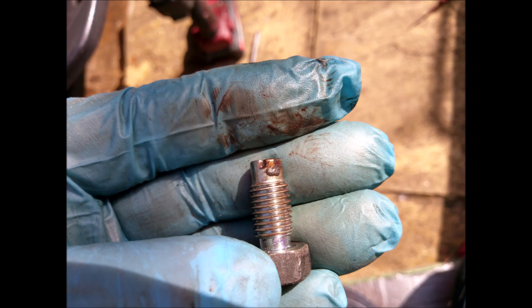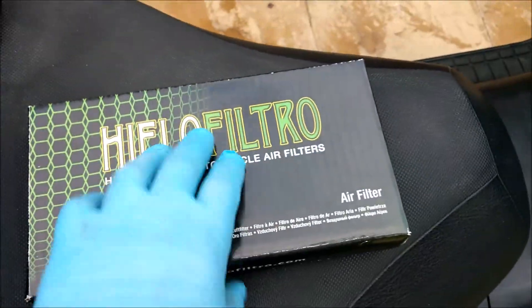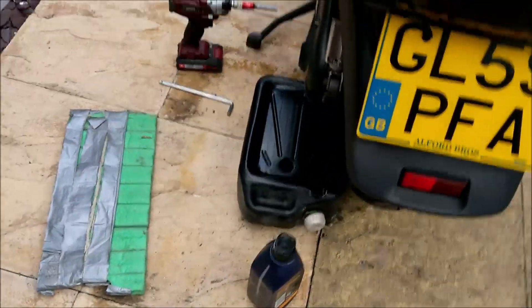Yeah, there's a lot of homework to do on this bike because it's colossal. Anyway, catch you in a bit. Hello again, good afternoon - it's another day. Right, we have the air filter - postie has been. I'm going to install the air filter in a minute. But first I'm so intrigued by that diff oil constantly coming out like a green colour. The first drop it was nasty proper snotty green. I filled up with hypoid oil, thought great. As you saw, I drained out again last night and it was still green. So now I'm going to do it again for a third time.